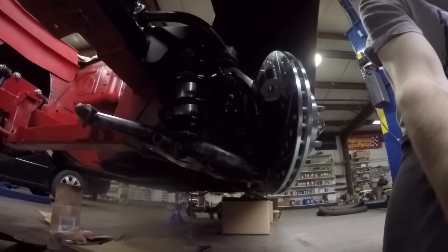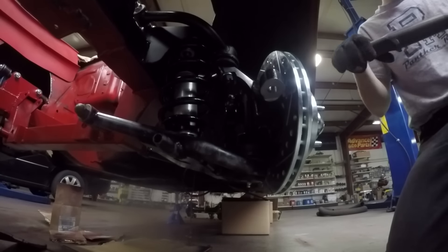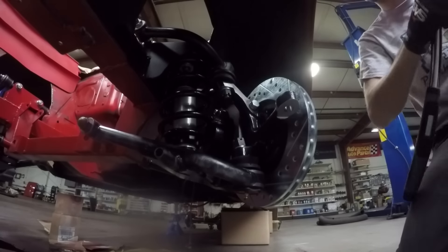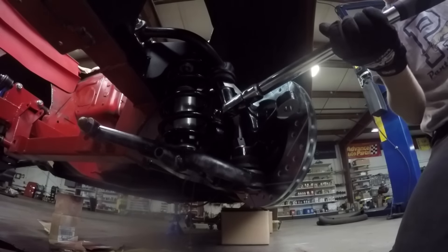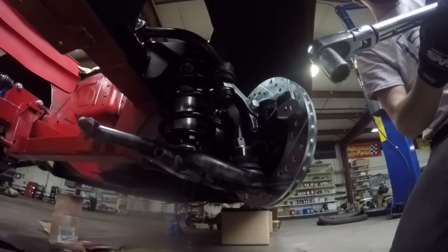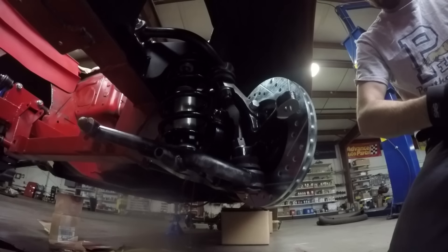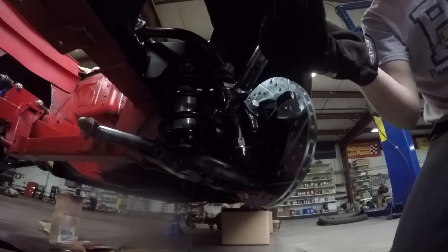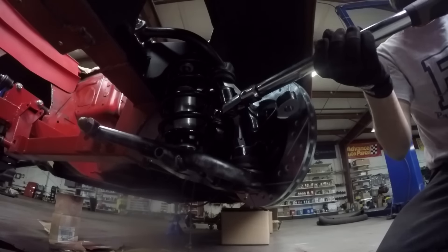As for the coilover, since these are adjustable coilovers you just slide the coil over the shock. The only challenging bit is the adjustment knob on top — you're going to need a star driver; it's not a hex nut. Unscrew that and it just lifts right off, then the nut comes right off and that's what slides up through the spring perch. Out of all the things to do, this was the easiest.